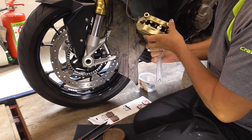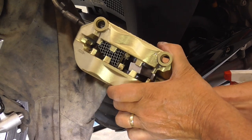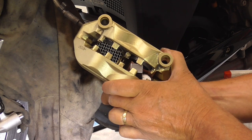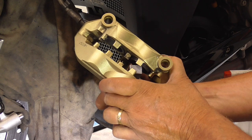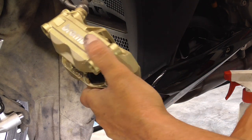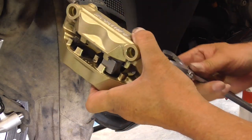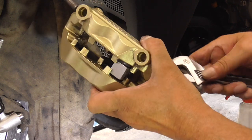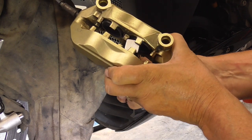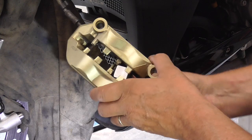So, and then now, watch. Carefully turn, and there you see? I'm barely putting any pressure onto it, barely, and there they go, hop, and I didn't scratch the pistons because I didn't use any brute force. You never need to use brute force, at least not at first. Okay, and now, oops, see, it slides in easy too. See, those come out a tiny bit, but that's good.